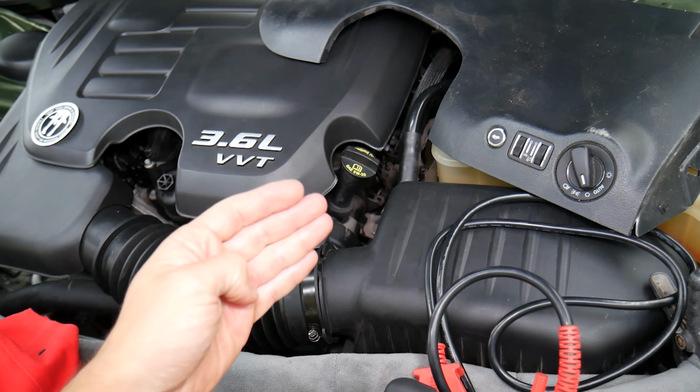Those are some of the most common things. Start with the bulb, fuse, then reset the system, inspect the wiring harness going to the headlight to make sure that they're not loose, broken, or contaminated with water. Because sometimes from rain and stuff like that, if the gasket goes bad, it can actually let the wires get soaked and they can corrode, and that can cause problems as well.